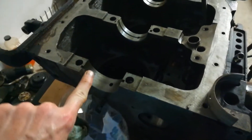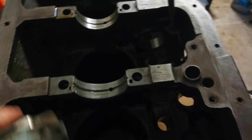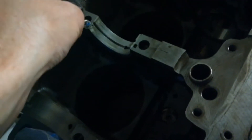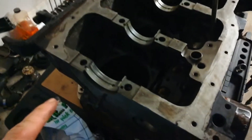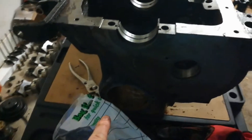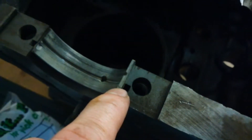Getting those bearing plates out of there too. You just take a little flathead to pry at the corner to get it started, then pop it out. I want to make a note of that little notch indention — it's on this left-hand side. Looking at it upside down, this is the front where the water pump is; the other side doesn't have that indention. I want to keep track of one, two, three, four, five — keep them in order, just in case.